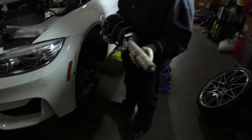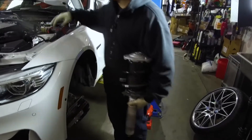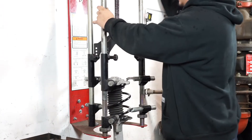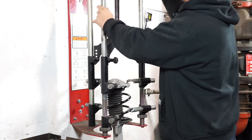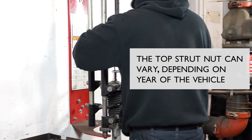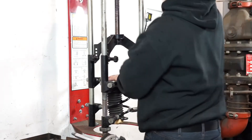Now for the disassembly of the front struts. If you don't have the proper spring compressor, we recommend that you take it to a shop or seek help from a professional, as damaging the strut will cost a good amount of money to replace. Using a spring compressor, we compress the spring to the point where the strut is backed off the spring cup. Next, we'll need to take apart the assembly by taking the top nut off. This is achieved by using a pass-through socket that lets a 10mm allen slip past to hold the strut rod in place. After the strut nut has been taken out, simply take it apart and back off the spring compressor.